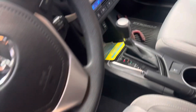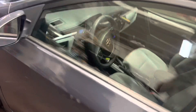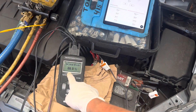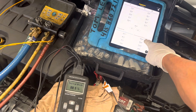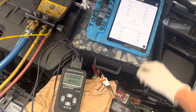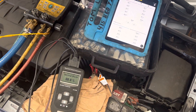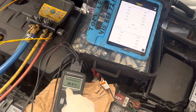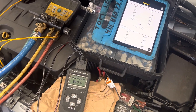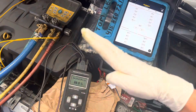We're just reading — I'm not commanding right now. So let's take it off recycle. High fan speed — so now there'll be a high load on the evaporator. Right now we're commanding maximum, and you can see the high side will stay up here longer. Because I have a heavier load over the evaporator, the low side pressure will go up and the signal is going to stay. You'll no longer see the compressor be commanded to lower its displacement on the swash plate because it's under a high load trying to cool off the cabin. It has full displacement right now.